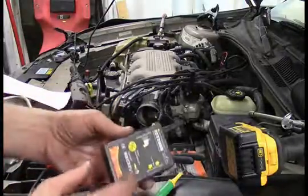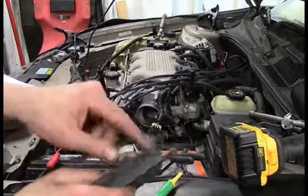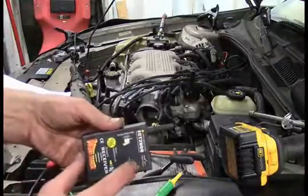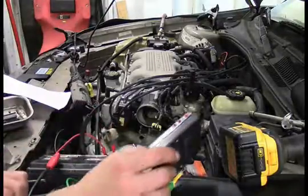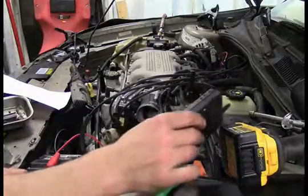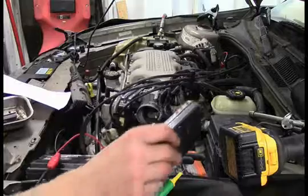You can use it either direction, but you can see it's all just a sound sensor. But I like looking at the light. If you have a short to ground, it shows you which direction the short is going to be. With this being an open, of course, those arrows are useless. And we see that the signal disappears when we find the open. So this is the region where our open is going to be.